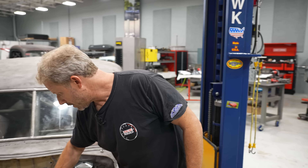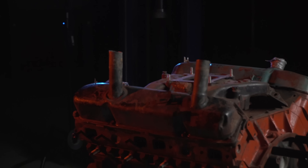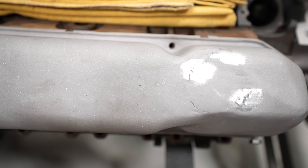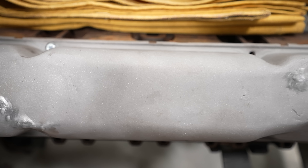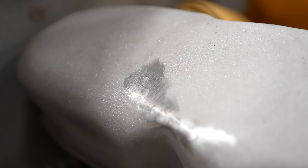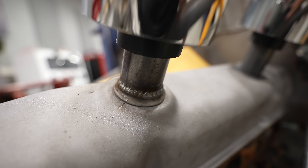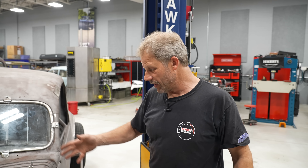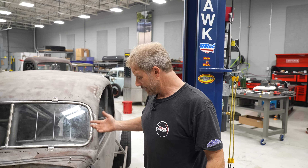We finished up modifying some stock valve covers. If you go way back when we started this, the stock valve covers had some stanchions on them for breathers, but they were kind of cobbled-looking. So we smoothed those out, got rid of all the stock tangs for holding spark plug wires, plugged two holes, then added a hole and used an existing hole to put the riser in. Now we have two crankcase breathers, and that will allow the crank pressure that builds up naturally to vent. You put those on the left-hand side of the car because you're turning left — everything momentum-wise is going to the right — so instead of risking oil getting pushed out of breathers on the right side, you let the air come out on the left.